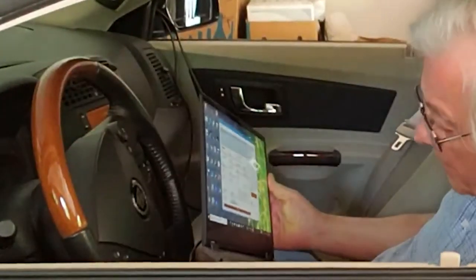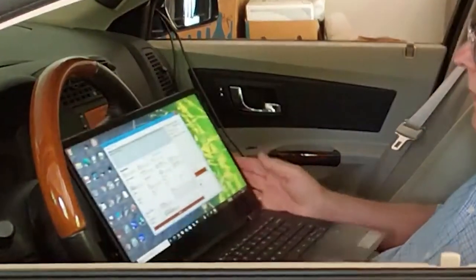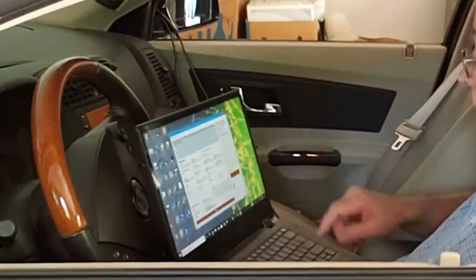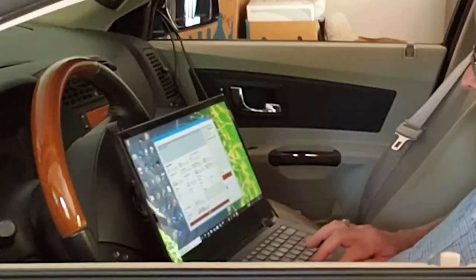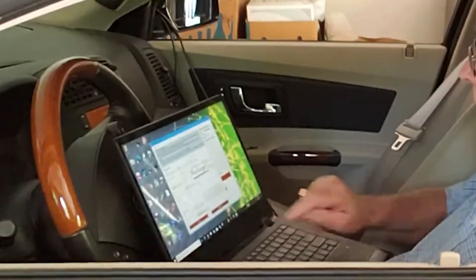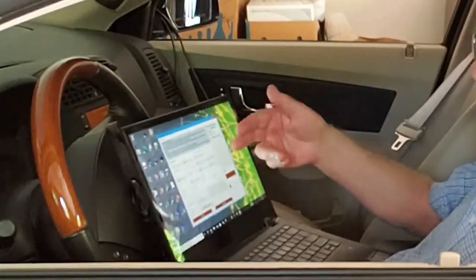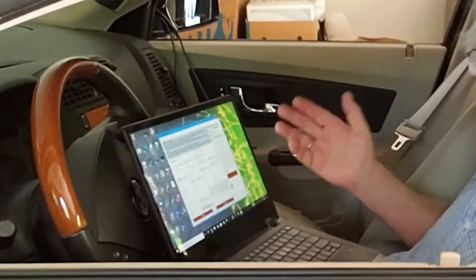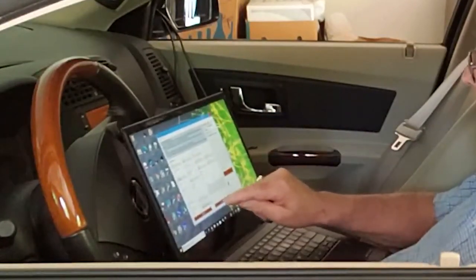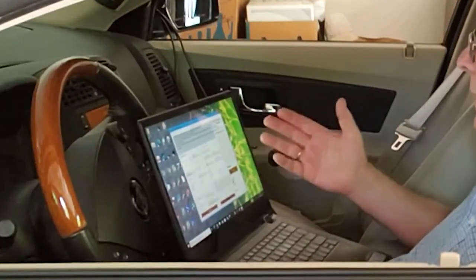Now I'm getting into the car — it's already running and all warmed up. I've plugged the PicoScope into the laptop. Since I've already keyed the data in on the screen we just discussed, I quickly review it. When I hit Next, the PicoScope will start up and the program will determine the duration for the signature and the frequency for the readings from the sensors, then send those parameters to the PicoScope. The upper window lists steps to be completed for a final check.